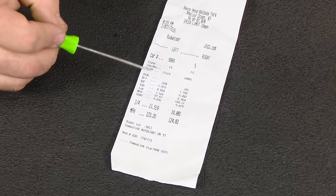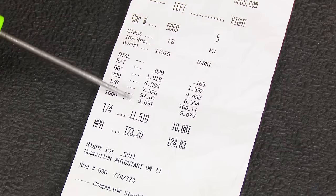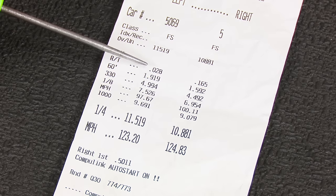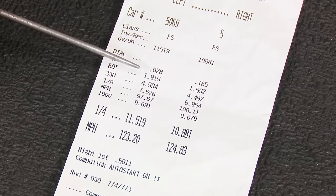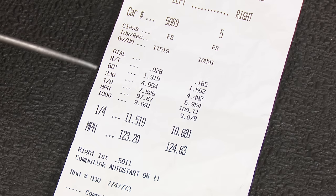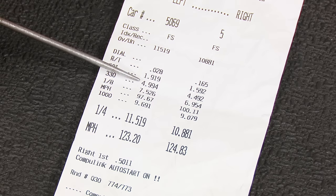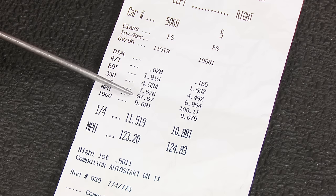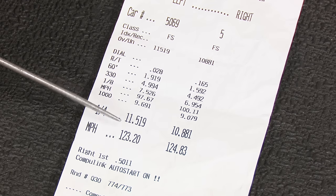On the way back you're going to pick up your time slip. RT is your reaction time — that's how quickly you reacted to the light. A triple zero is the dream, that's the perfect light. The next one is your 60-foot, which usually makes or breaks a race. The better traction you get, the quicker your 60-foot time is going to be — for a street-tire car, anything in the 2.0 range, low 2s or high 1.9s is about what you can expect. Next is your 330-foot time, then your eighth mile with your first speed. This tells you how quickly you covered an eighth of a mile and how fast you were going. On a quarter-mile track, the next line will be 1,000-foot, and finally the bottom number will be your quarter-mile time to the thousandth along with your speed.